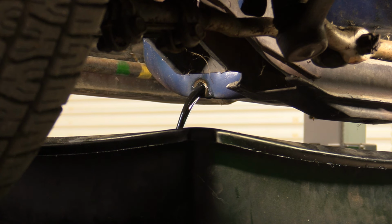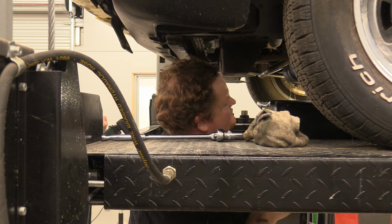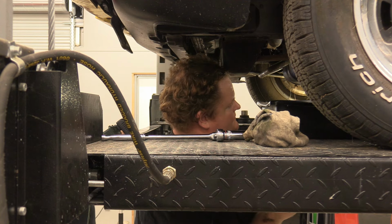And as time went on, the Cobra Jet got less and less. In 1973, they saw a smaller valve size, but that didn't really change the mammoth ports. Honestly, if Ford had been really smart about this engine, they probably would have gone in and made these a 383 or a 390 and just dumped the 390 altogether. But those engines were going really well in a lot of other applications, and Ford didn't want to change that. So we got stuck with a smaller displacement that really needed to be a bigger displacement, like a 383 or 390. They could have even made a 429, but that would have been really confusing.